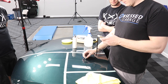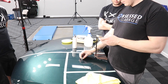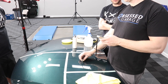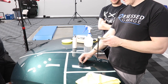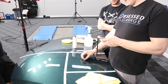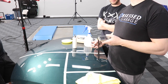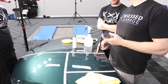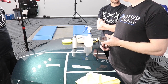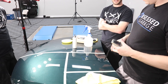So 100, 96, 102. Right in this spot, I was measuring anywhere from 102 to 110. And I'm measuring 104 over here on the left, down to say 90, 100, 98. So my 2000 grit followed with 101, I'm removing somewhere in the order of 6 to 8 microns. That's about right, which isn't that much for someone that has really never sanded.